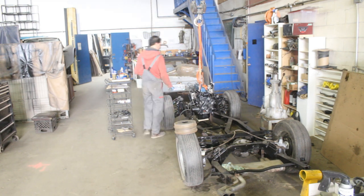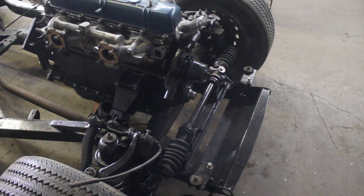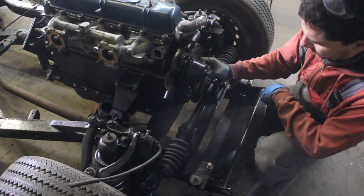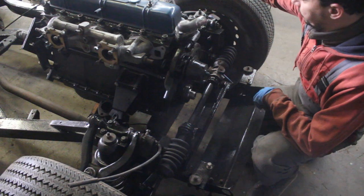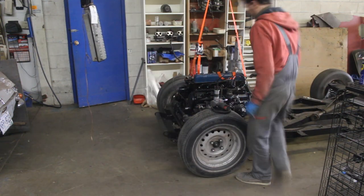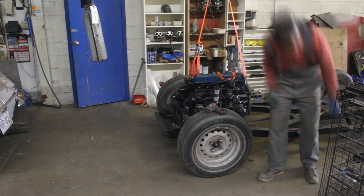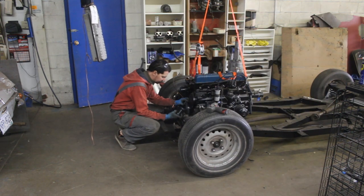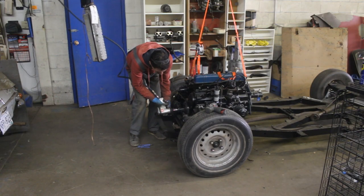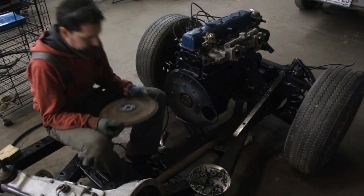I held the rear end of the engine with a jack underneath because the transmission was not on yet. Here's another mistake — I should have installed the crank pulley before I dropped the engine, because now the steering rack is in my way. Good thing I caught that in time, because I had to lift at least one side of the engine again and install the pulley. This by the way is not fast forward — this is the usual pace of my colleagues; this is how they work.